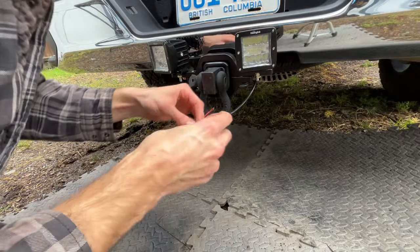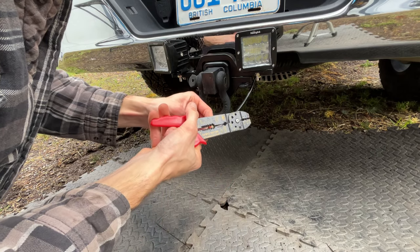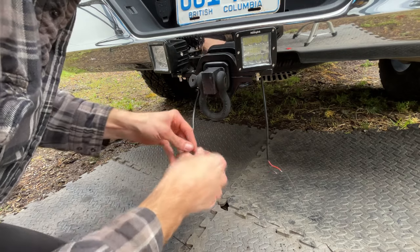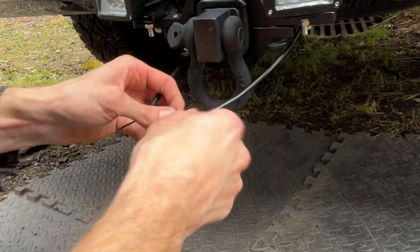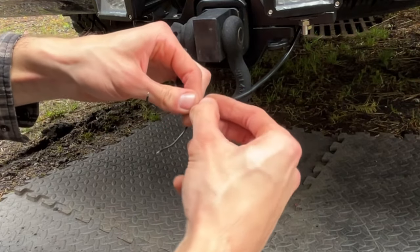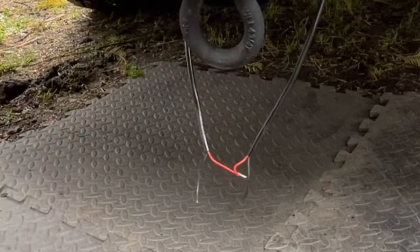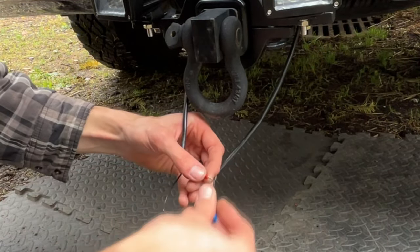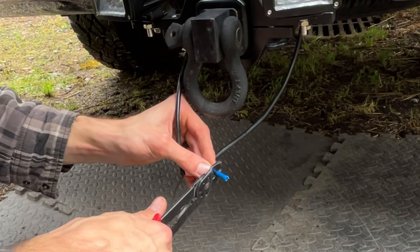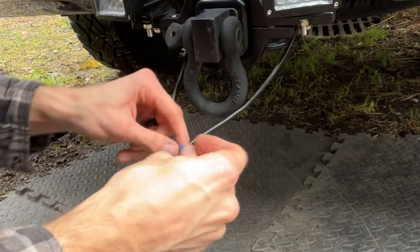While I got the wires out, just snip the ends off because they have solder on them — I'm not going to be using solder. I never have and it's always been okay. I'm just going to give some wire here and get the wire from this one. You could go for a splice or you can go for a double crimp. So we just wrap these up around each other — we've got two wires, just tangle them up so it becomes one. I'm going to be using a blue crimp. Crimp these — nice connection here. Slide the crimp on. Just like that — we got a good connection to our red wire.